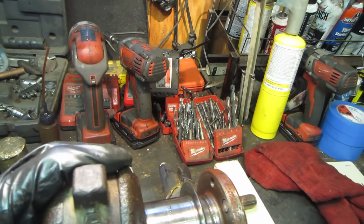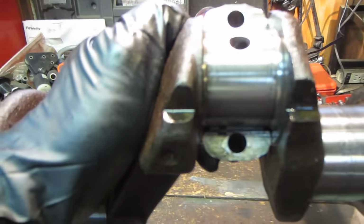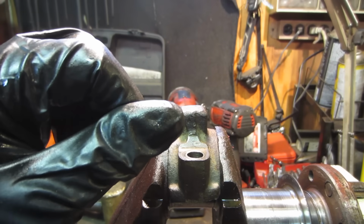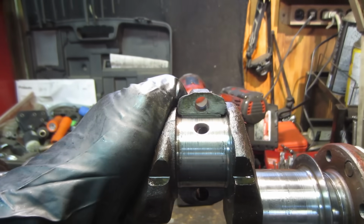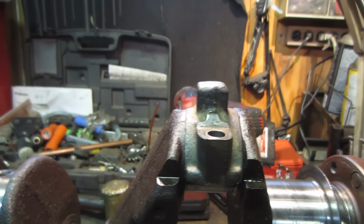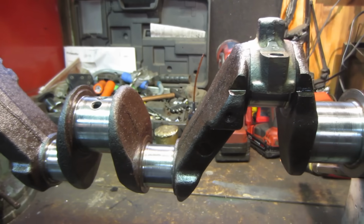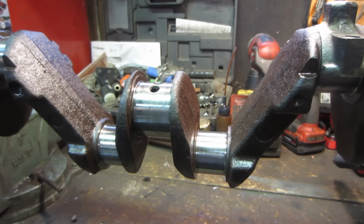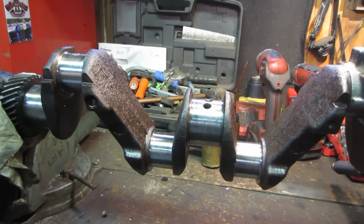The material starts, the bearing starts deteriorating on itself, and it starts, I call it galling, which is metal getting removed from one section and then welded back on another place, kind of like when you strip a bolt out in a hole and it seizes. What I felt was happening was it had some rust or other contaminants inside, and it went through and did that to it. But after opening that oil pump and seeing how much play was inside that thing, I think that might have aided in some of the issues it's having.